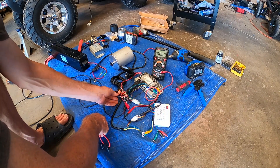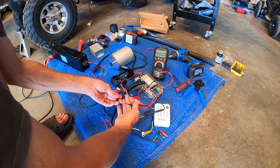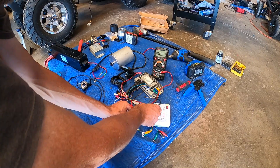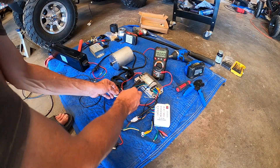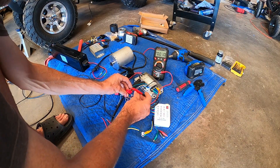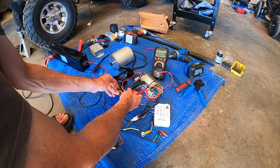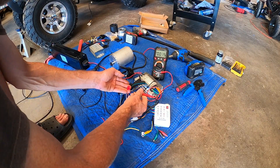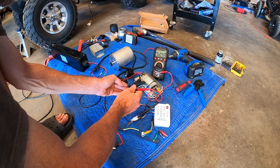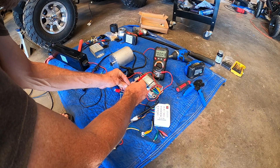Brake switches also operate on 5 volts most of the time. I know this is a brake switch because the two connectors are wired together like that - on bicycle controllers that's always how they are, and it will be 5 volts. Probing through these pins - something like this red connector is probably power for a DC-to-DC converter, and it shows battery voltage, so don't short that. Four-pin red connectors will have battery voltage on one leg. This one looks like a key lock or alarm connector.